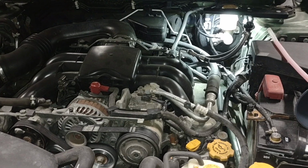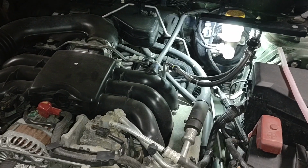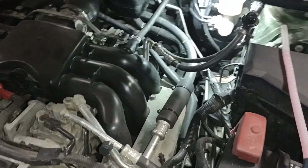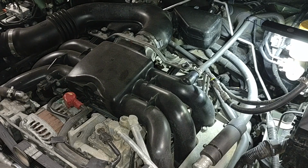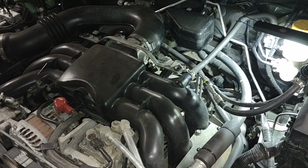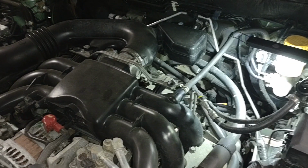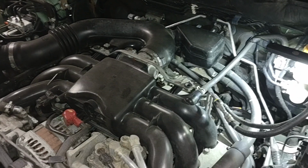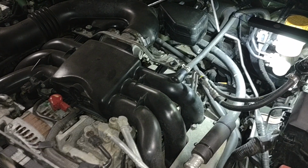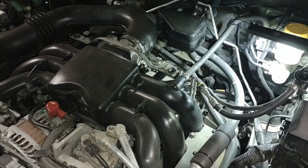Okay, about 20 hours have elapsed. The sealant on the transmission pan will have well and truly set up. It's time to fill the transmission once again. Now normally, if you followed my advice and you captured all the fluid that came out in the various tidal waves, you would have known how much you need to put back in by just measuring it in other bottles.